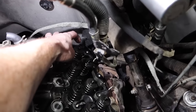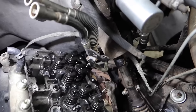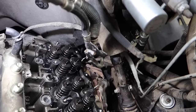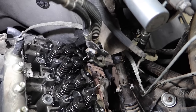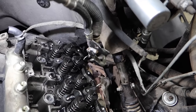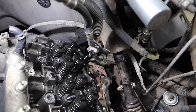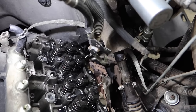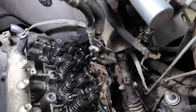The rear bolt on the driver's side down low, you see where Josh is pointing there. Yep. That bolt there is going to need to be left in there. You can get it loose, you can get it all the way up, but it will hit the firewall as you try to pull it out. You're going to see when we put the remachined heads back on, we're going to prep a stud, a washer, the nut on there. Again, we'll put this in the video when we put it back on, but you'll see we have to do that ahead of time. Otherwise, you'll drop the heads on, but you'll not physically be able to get the bolt or the stud in there. So for what that's worth, that is normal and that will hit. You can leave it in there.